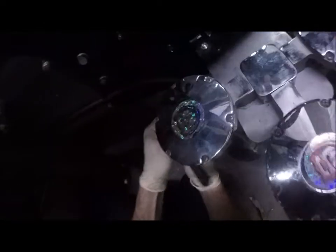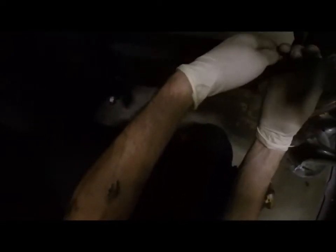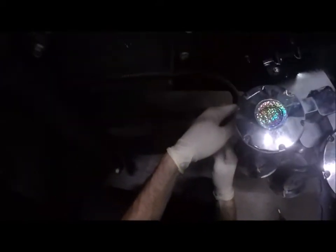All right, so push to connect fittings have a collar on the back, and you take the line and you shove it in there, and it should lock itself into place. Generally they go in about a quarter inch. All right, so that's locked in there. Let's get our wire connected. So we got that right here. Okay, and that should do it. Yeah, that should do it.